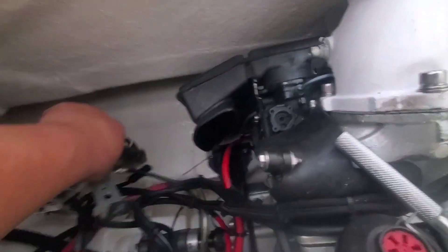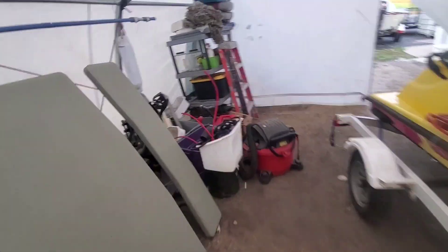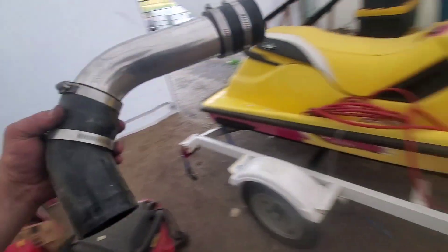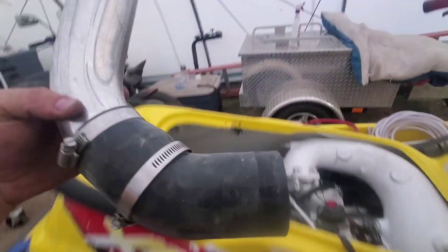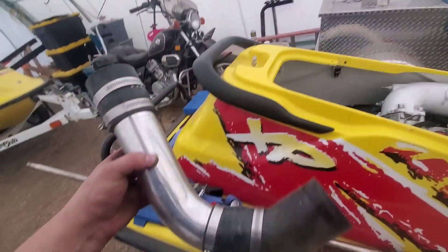I switched over to a carrier bearing — I had a carbon seal before. The water box crossover pipe comes out from there, crosses over, and goes right over that, so hopefully in the long run I'll come up with something else to grease it — maybe put a 45 in there and get underneath from the side. But it's not too much to undo: loosen up these clamps, undo that, pull it off the water box, grease it, and put it back. A little inconvenient but not too hard.